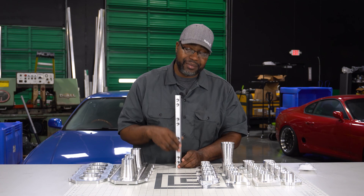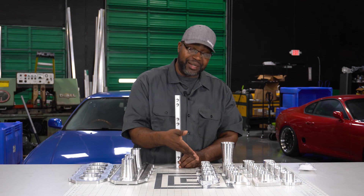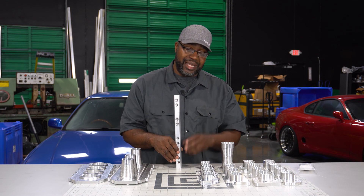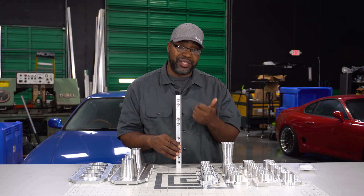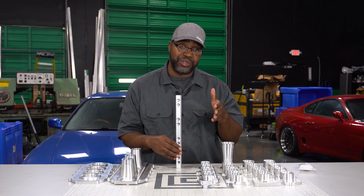Without the compromises those manufacturers had to make — I'm not saying they cheaped out, they just went a different route. Part of the popularity of these kits is definitely because guys love the fact that their injectors are side by side. Moving the injectors from the bottom side of a runner or stacking them behind each other, it's a lot simpler for setting up your fuel system — less fittings, less lines, and you get more repeatable control flow. You can stage your injectors for big power builds, or split the output so they're always driven at the same time.